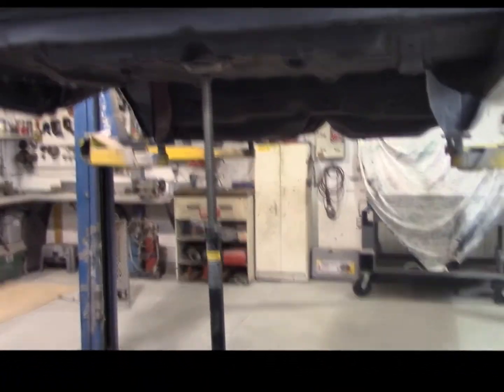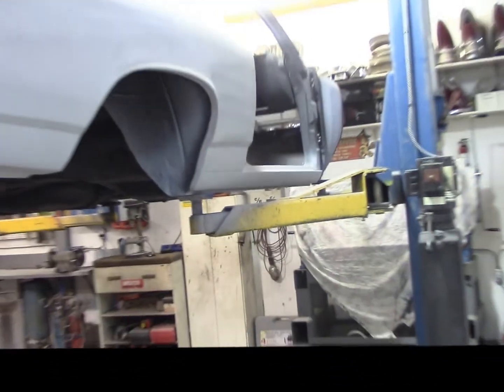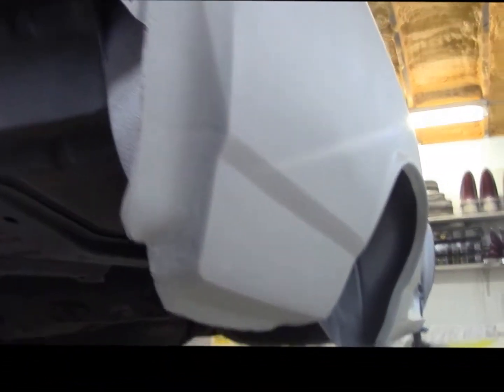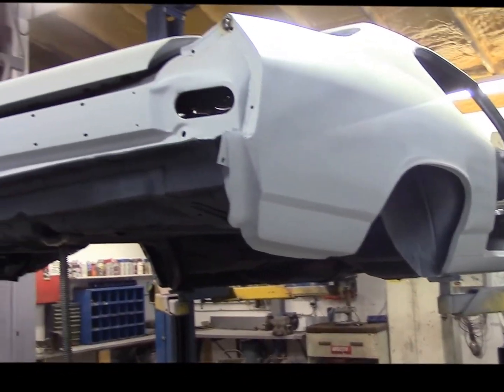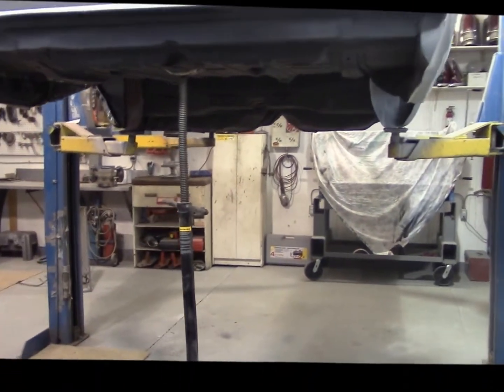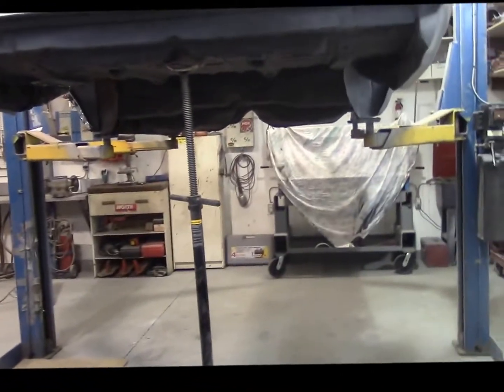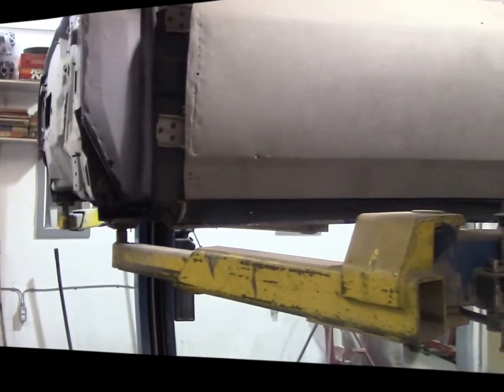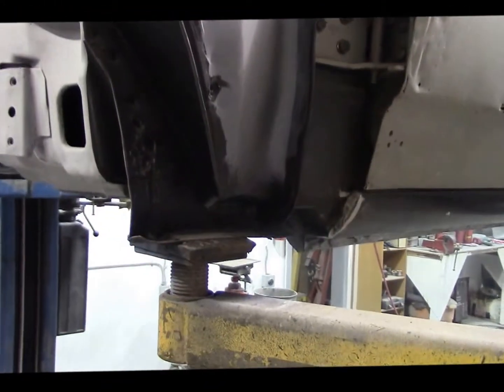I would love to lower it down for you but I can't. As you can see right there, I've got my safety stand. The reason for that is if you take a look where the hoist arms are, there's really nowhere to put them at the back and the hoist arms don't swing out far enough. The car is on there good and solid. When you've got a hoist, you always give it the old rocking motion to make sure it's solid before you get it off the ground — get it up a couple inches and give it a good rocking motion. I've put the stand here just in case because the back end is a little heavier since it's hanging over so much. Up at the front the car is right up at the front, so there's no possible way the car is going to tip forward with the arms positioned right there.